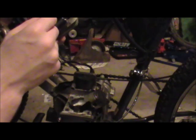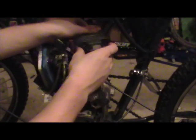Let me check this out. There is some scoring in here but it's pretty smooth — I can feel a tiny bit right here. Barely any carbon on the head. It's like almost nothing in the exhaust port. That looks pretty good. I'm gonna probably pin that out some.